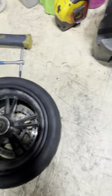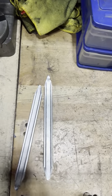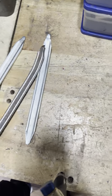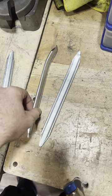It took us a long time to dial in this process, but we've been able to get a solid rubber tire installed in about two to three minutes. For tools, you're going to need heavy duty tire levers. We've got a few of these — as you can see, a couple of them have been bent because you do need to apply a ton of force to get the tires on.